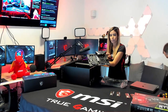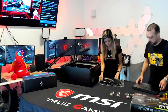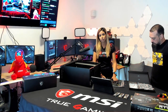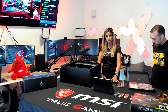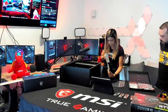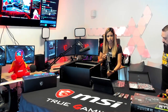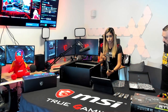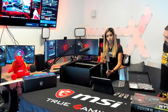I'm going to post all the pictures after the build. This is a beautiful, really advanced motherboard. It has four M.2 NVMe slots — one Gen 4 and three Gen 3 — all with aluminum covers, which MSI calls the Frozr. You have three PCIe connectors, Audio Boost 5 with a built-in amplifier, and in the back panel there are eight USBs — six USB 3.2 and two Thunderbolt ports — plus two mini DisplayPorts for up to 8K, Wi-Fi 6E, audio jacks, and an onboard HDMI.